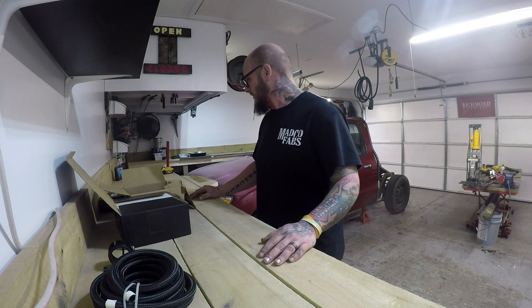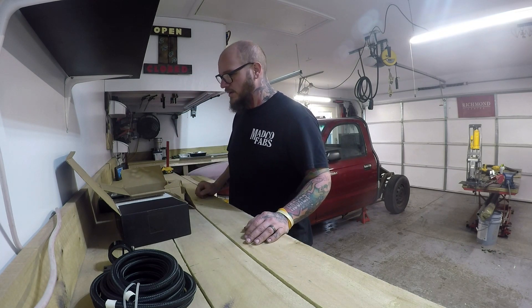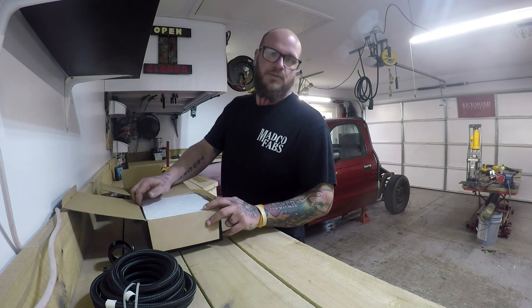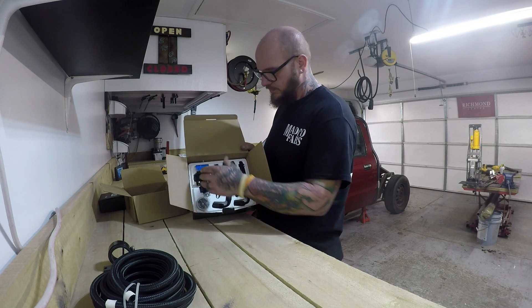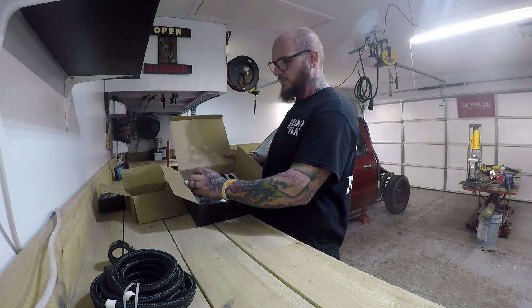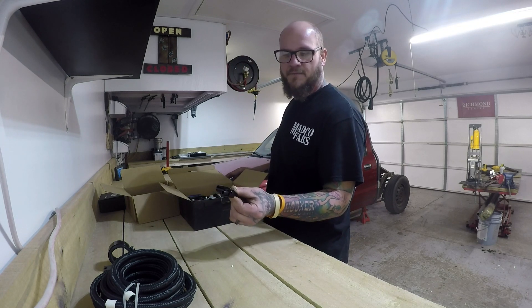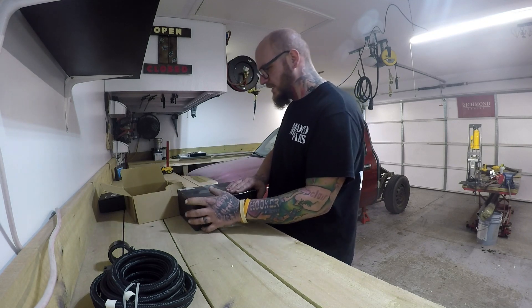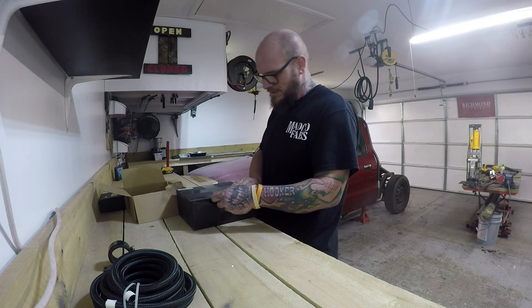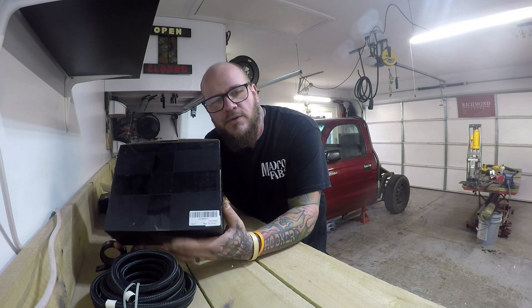It was originally going to be just all drift, but now I'm thinking some crazy stuff because I'm having fun building it, and that's just what happens. Some of the things I'm thinking now are ease of working on it and ease of getting things in different places. Another thing I had to get my hands on was a fuel regulator kit — fuel pressure. This just regulates the pressure going into the motor because your fuel pump can produce 90 pounds and you will blow your stuff up. So you have to regulate that pressure. Now, this is the part where most people get pissy and I don't give a shit. I ordered everything off eBay and I went with cheaper suppliers.